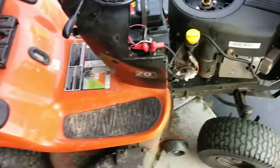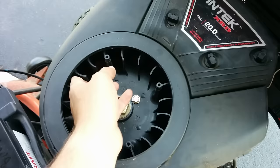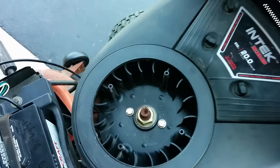I was kind of surprised because this is a five-year-old Ariens with a Briggs engine and the oil was just done on it. What happened is the engine was actually seized up. So what I did was take this cover off and manually push on it to get the engine to turn over. You don't want to push too hard — use two hands because this is plastic — but that freed it up.